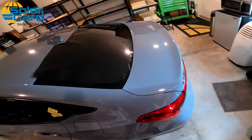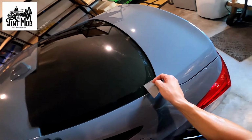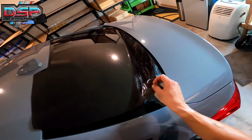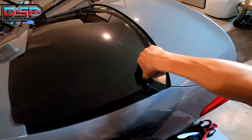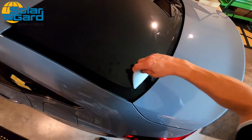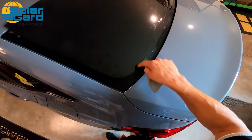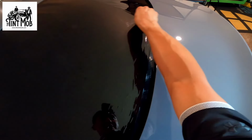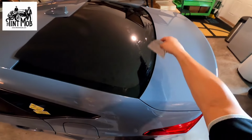Now, back to the double snap. We're gonna take this finger, we're gonna lift up the bottom 2 inches, okay? We're gonna lay it down, right? Nice and easy. Now, we tighten up, we never shrink the quarters, the corners, okay? So we're gonna keep that nice and tight, and then we haven't shrunk this area, so I'm gonna hard card it there. Notice we have some more fingers now here, right?